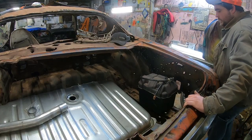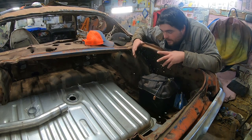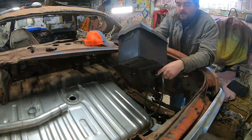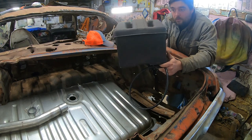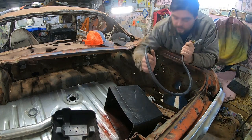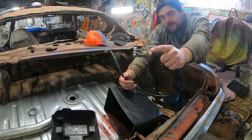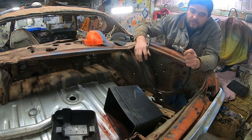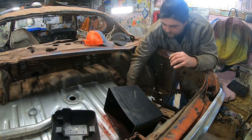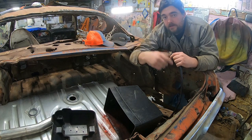So for starters back here, obviously we are missing the trunk, so we're just going to have to kind of eyeball it for now until I can get enough road signs to make a trunk. Get yourself a battery box — it's a marine battery box. You can get these anywhere, Walmart or whatever. That's an old one out of one of my race cars, so reuse. I made this battery cable out of a piece of jumper cable — this is two gauge — put two lugs on the ends, and I like this style of battery terminal. To ground it, we'll find a hole or drill a hole in the frame down here, and we will bolt it direct to the frame. And simultaneously we will ground the engine block to the frame up front, so there's a complete return there.